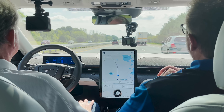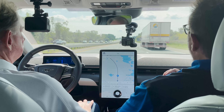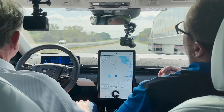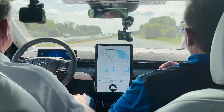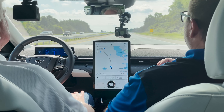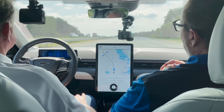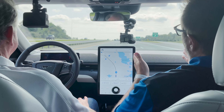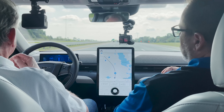The vehicle has a number of radars around its periphery that monitor surrounding objects, and we also use a forward-facing camera on the windshield that uses vision to monitor objects around the vehicle. That's all part of the Blue Cruise system — along with the driver-facing camera — controlling the speed and steering so the vehicle stays centered in its lane in hands-free mode.